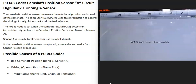How the vehicle's computer relearns varies. Sometimes you just need to start up the vehicle and the computer will automatically relearn. Sometimes you need to do different drive steps. Sometimes you can swap it out and the vehicle will just start up with no problems. If you have a really good OBD2 scan tool, quite often those have an option where they can automatically command the computer to relearn — these are the more expensive scan tools, but some of them do have it.